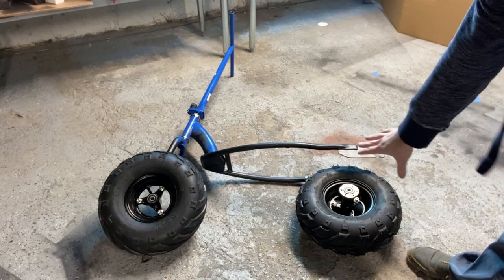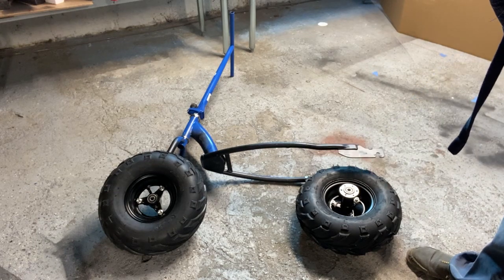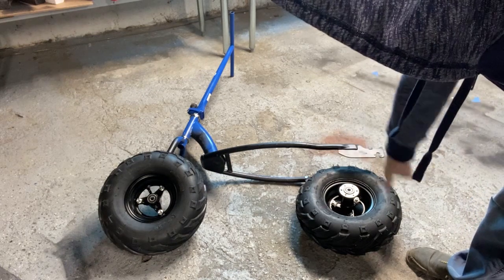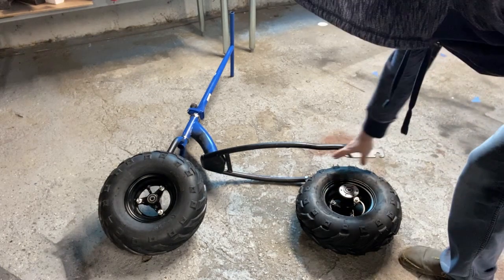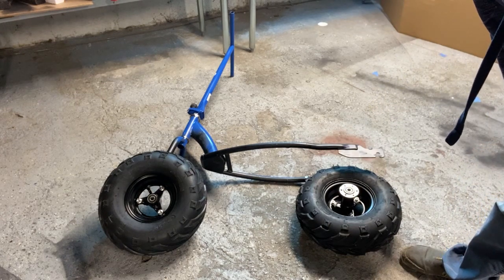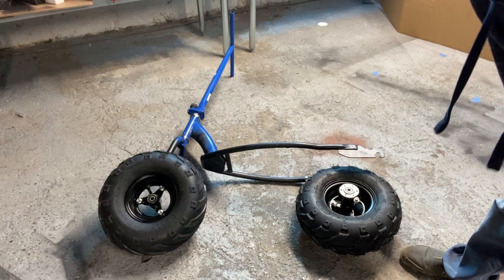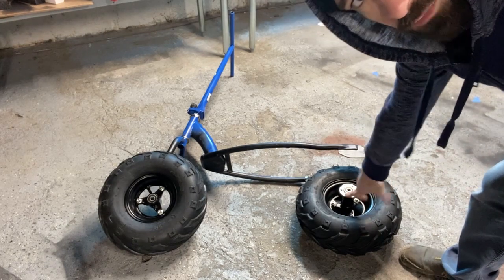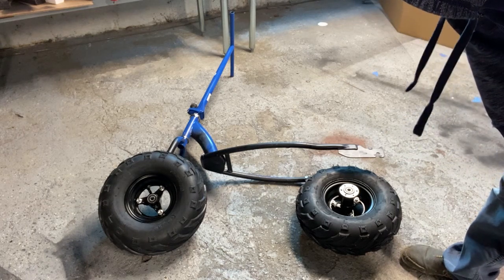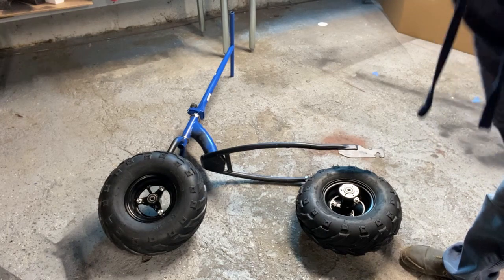We just have to figure out how much we have to stretch the frame to fit the wheel, as well as there's gonna be a brake rotor on one side and a drive sprocket on the other side that has to clear some of this metal. So we're not gonna know that until we get the drive sprocket in and the brake and get them all fitted up. We're probably not gonna be able to use these holes because I've heard they're M6 with a stupid thread. So I'm probably just gonna drill new holes and thread them for a normal M6.